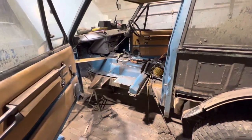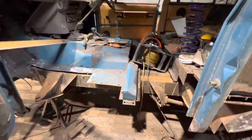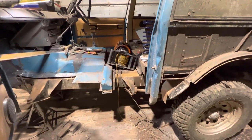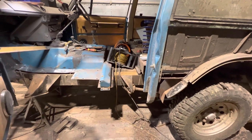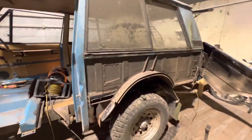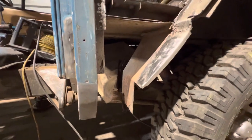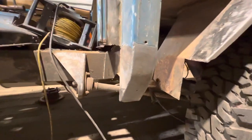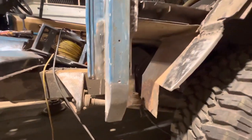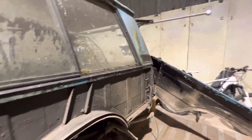Welcome to episode 9. Things escalated again - I did a lot of work off camera, mostly because you couldn't actually see anything while I was working. The amount of dust and dirt flying off this thing was horrific. We got the quarter panel off, just because I wanted to make a little repair panel in here and also around the lower B-post. It's a lot easier to take it out - it's only eight screws and about ten pop rivets. Still haven't left the lights connected, so nothing major.